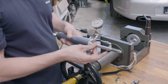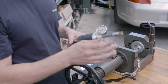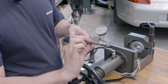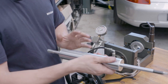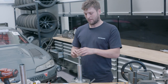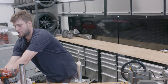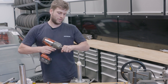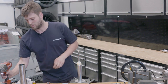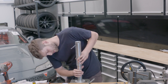With a 15mm rod we only run 1,600 kPa, whereas with a 12.5mm rod we run 2,000-2,100 kPa. Dependent on how much volume is increased by the rod versus the cylinder, we change how much gas pressure is needed to energize the column. Then we put our bump stop on first, then the spacer nut. Now we put the cylinder over the top making sure we don't pinch the seal.